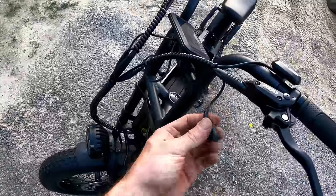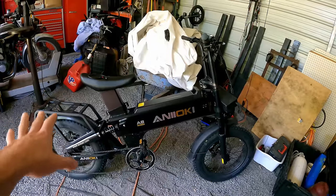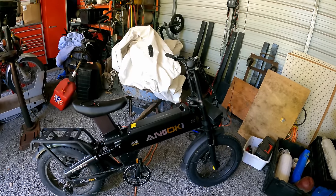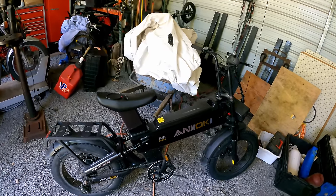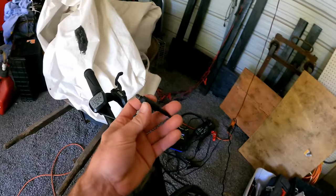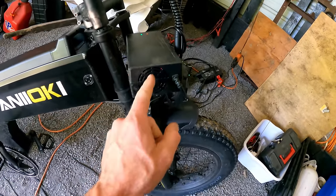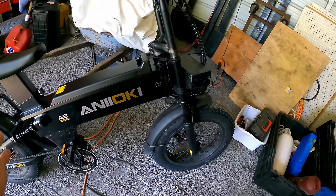I did notice I broke off the brake switch. Back to the morning after the long ride — I was pretty blown away. If we'd kept it on speed assist two or three, we easily could have put down 100 miles, hitting hills and all sorts of stuff. 87 miles was very impressive. The brake light switch came in the mail today — it was broken from the box, but it's a quick thread-in with a simple plug-and-play connection. The battery went on charge with the 8-amp charger, which kicked the fan on.